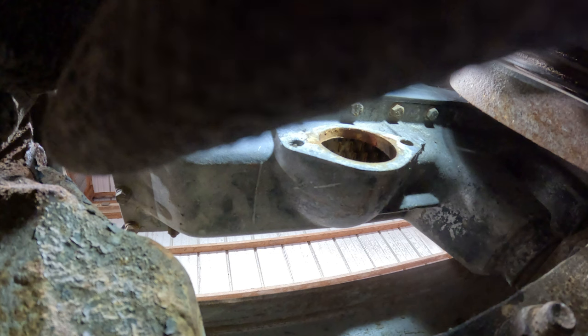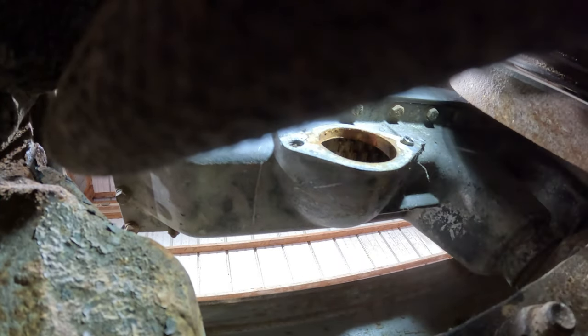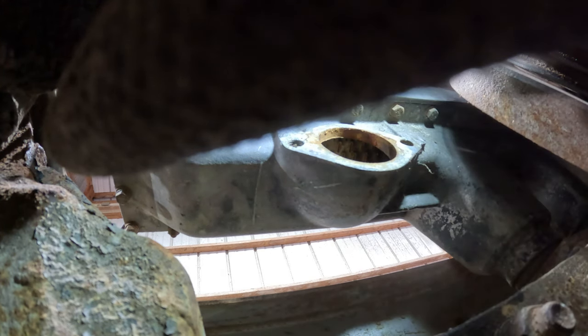Okay, I'm glad we looked at this and saw it. Well, I wish I realized that earlier. Because if you look, here's the helicoil, and it goes in there, like, just hangs out. Huh. So these are 3/8, so we're going to have to go bigger. Which doesn't give me such a good feeling.